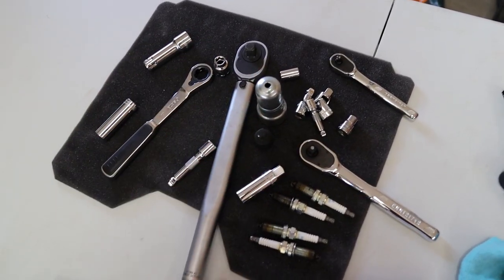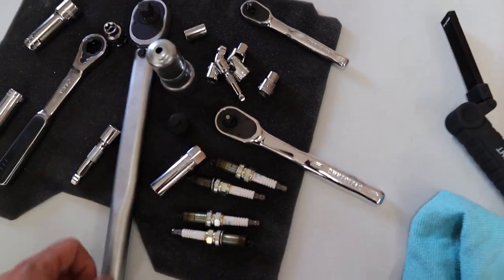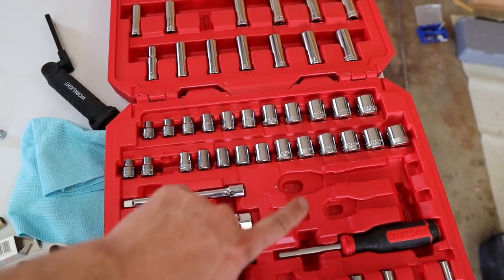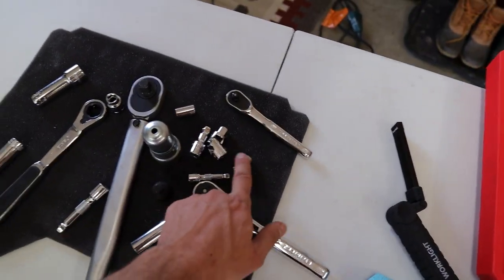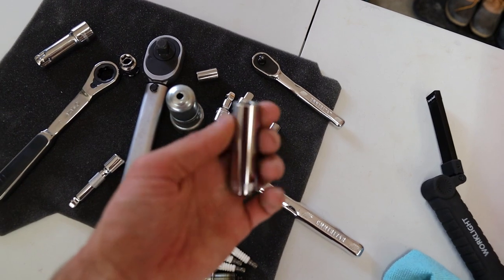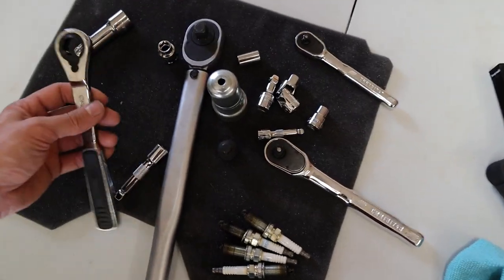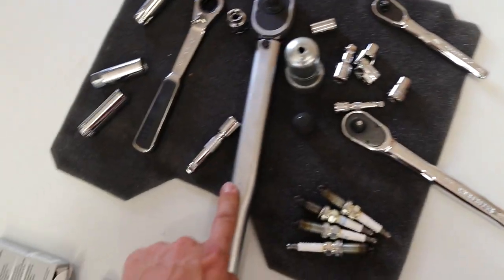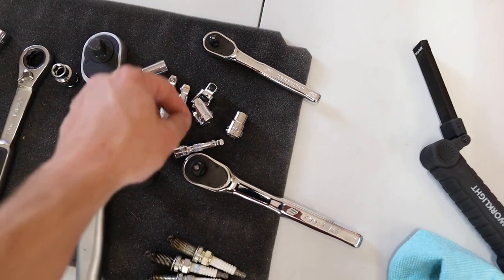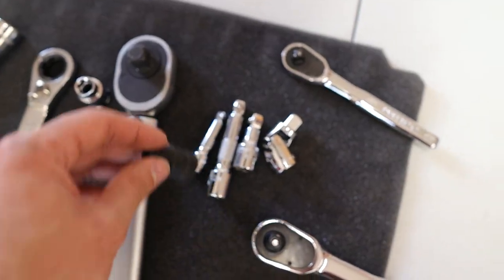This is everything that I used to adapt and find the right sizes. All the used plugs right here. I just used a general set that has 3/8 and 1/4 inch. So we had the 1/4 inch and 3/8 socket size for 10 mil. We used the 14 millimeter for pulling or putting the bolts in, the 14 millimeter special socket tool for retaining those spark plugs, the pass-through ratchet set for the battery, torque wrench, terminal battery cleaner, because I did that, and then all of these little adapters and extensions, and then a 1/2 inch to 3/8 adapter as well.